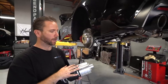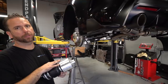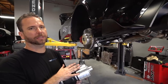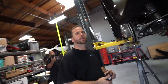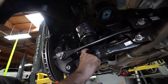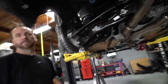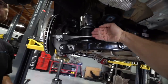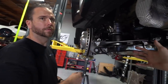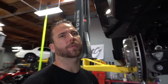We've removed the rear coil spring and we're putting in the rear air spring. This vehicle has divorced rear suspension where the spring and the shock are separate, so we're just replacing the spring with the air spring - the shock, damper, and everything stays the same. This is one of the things Zach measured when he was here a month ago - measuring out the opening and how far up we needed to space it to get the clearance. It's very tight all the way around. On BMW cars you'd have to make a custom arm with a bend around the bag, but on this car we have literally just enough space to fit a bag. We made a smaller bag specifically for the older 3-Series and it lends itself well to this vehicle as well.